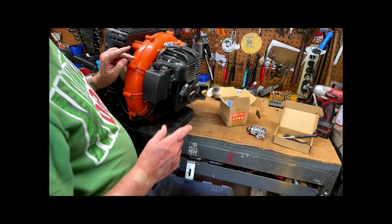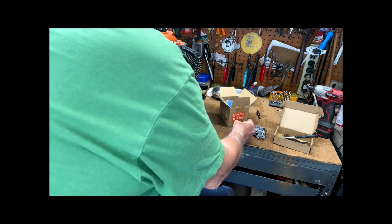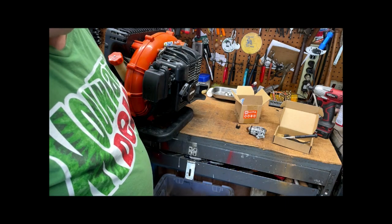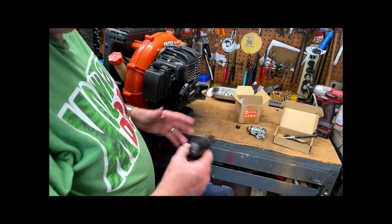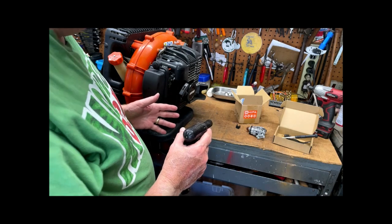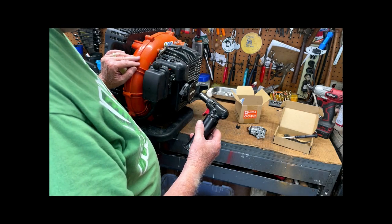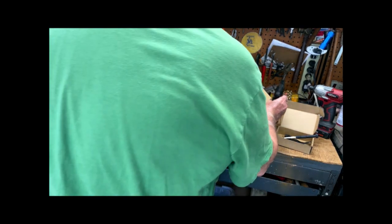I'll show you a tool I just bought. Have you seen these little mini blow torches? I bought this, I had one use for it. And since I've had it, I've used it half a dozen times. So much easier than fooling with the big torch, if you're trying to heat up a bearing race or something like that that just needs a little heat, or even seal up shrink tubing on a piece of wire. Very handy little tool. Sandico is the brand here, and I thought I would use it one time, and I've used it half a dozen anyway, so it's been very handy.